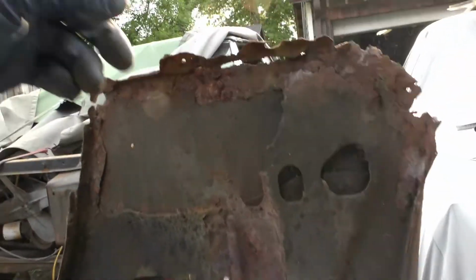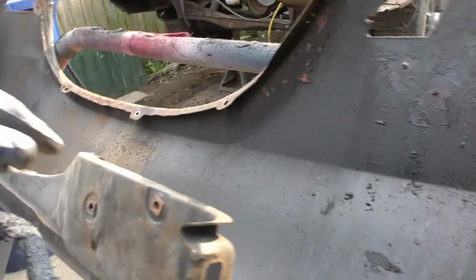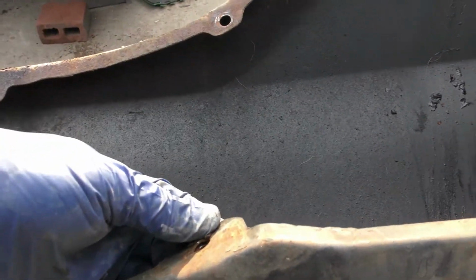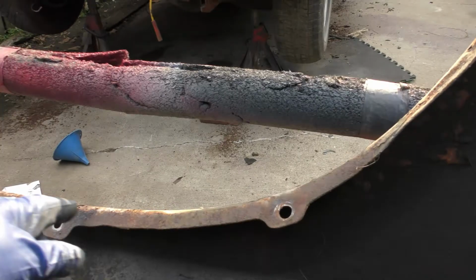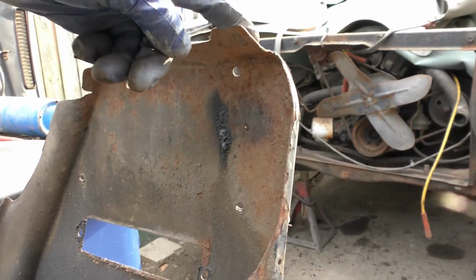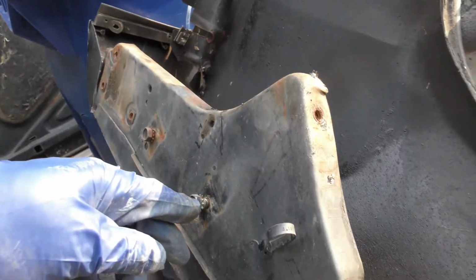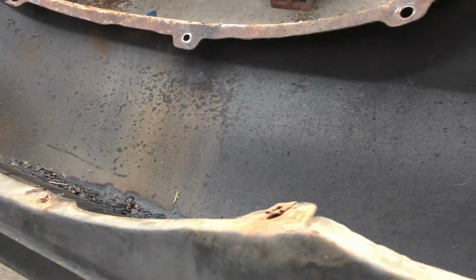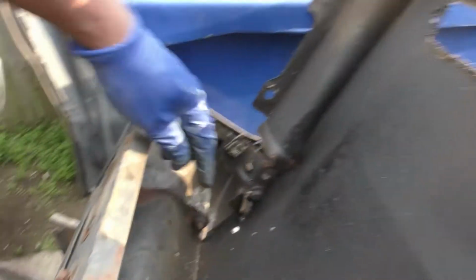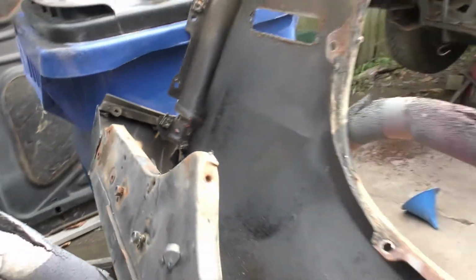All right, so to wrap this video up, like I say, it's a bolt that's normally right here in this area. It's one here, this is the top. It's two here. Then of course you gotta take the door hinge off. Now these clips, I save all these clips. I knock that clip off of there. But then you got 1, 2, 3, 4, 5, 6. You got 6 around there. You got 2 here in the front, 1 down here in the bottom. Then you got 3 here for the radiator support, of course. The horns go here. And then you got these 4 on the inside. And then that fender is ready to come off of there. So you take these out, and this is all smashed too, and then this front piece will come off of there. So that's how you take these fenders off, guys.